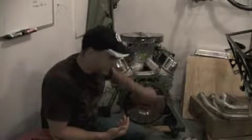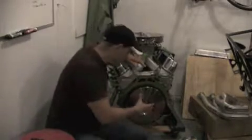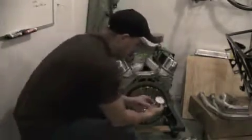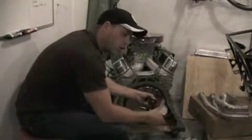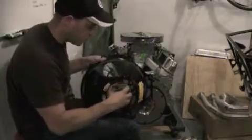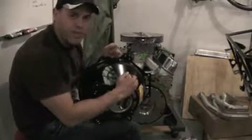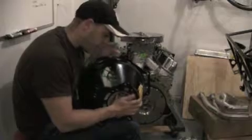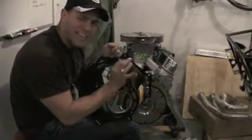Essentially what you do is watch that dial go around. You plug the bell housing on top of the dial gauge and have the stylus — the tip of the dial gauge — riding along. As this turns around, it'll spin around and measure how close the cutout is and how close the center of this hole is lined up with the center of that hole. Believe it or not, the acceptable tolerance is only five one-thousandths of an inch. Five one-thousandths of an inch is about the thickness of two sheets of paper — very, very tight tolerance.